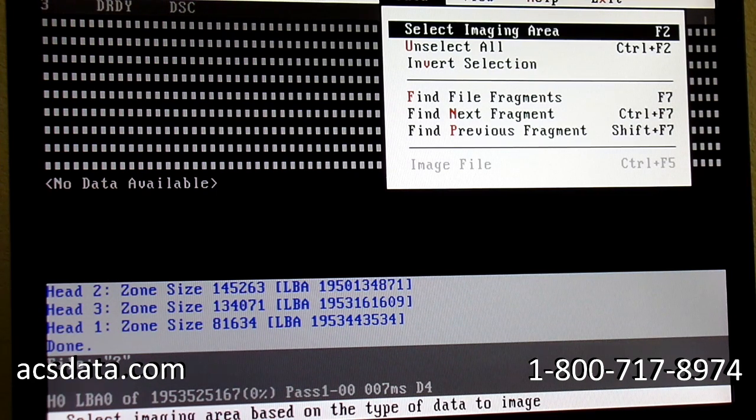It's probably going to be in a really degraded state. If there's an issue with the platter surface itself being damaged, you may end up damaging these replacement heads. There's a lot of limitation once the heads are swapped out in starting the process of recovering the data, and that's where having the investment in equipment comes in handy. We use DeepSpar Disk Imagers. We have multiple imaging stations like this, and they give you flexibility. They're not like normal cloning software out there; these are hardware-based imagers.